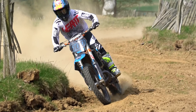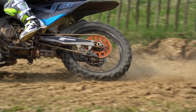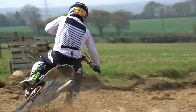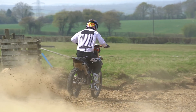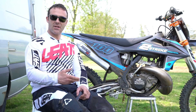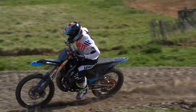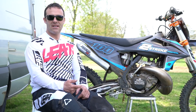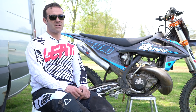I like it so when it comes out of the turns, I know what the throttle's going to do and I can basically trust the rear wheel, and get the spin on if I want it to slide. If not, I can take a gear higher and I know the bike's going to pull it — basically there's more torque. You've got to feel it out on track and feel what works for you. Some riders like the power to come in a little bit early on the throttle so they can get that bike spinning a little bit early to help turn. Some don't — they just like it to drive coming out of the turns. The harder that you go in with the spring, the less spin you're going to get and the less aggressive the throttle hit will be.